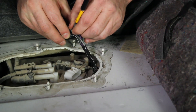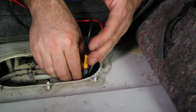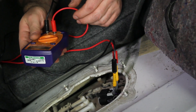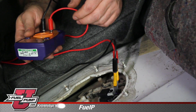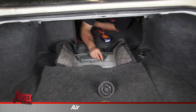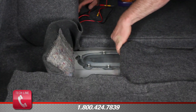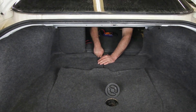With our available voltage being good, the next test we'll do is a voltage drop test. We'll energize the circuit by turning the key to the run position and plugging the connector back into the sending unit, with our voltmeter leads still back-probing the proper circuit. Your voltage drop reading should always be less than your available voltage reading, because of the resistance created in the sending unit. During our voltage drop test, this shows that there is actually resistance through the resistor in the sending unit, which tells us that the circuit inside the tank is functioning properly. If your voltage drop test shows the same as your available voltage, then we have a problem with the sending unit in the tank. With our voltage test at the tank, we've determined that the sender is working properly.